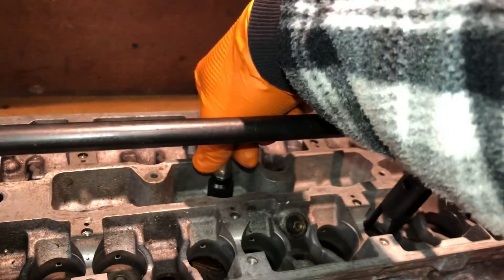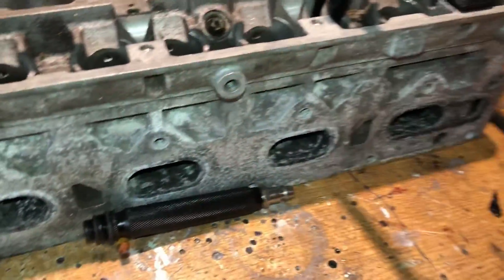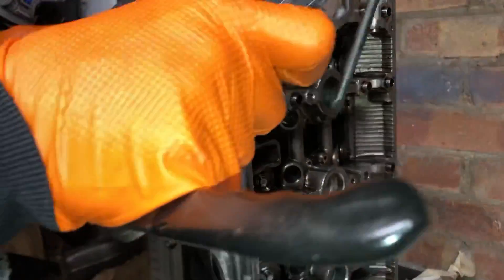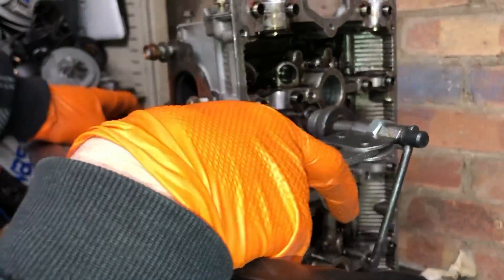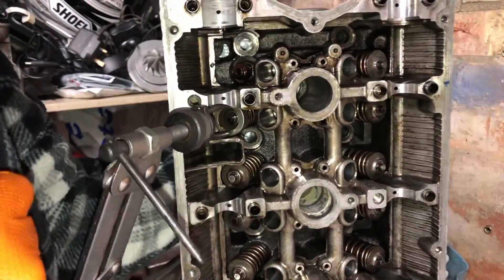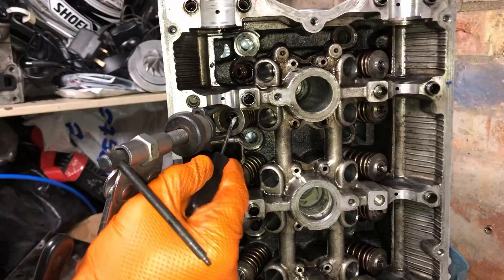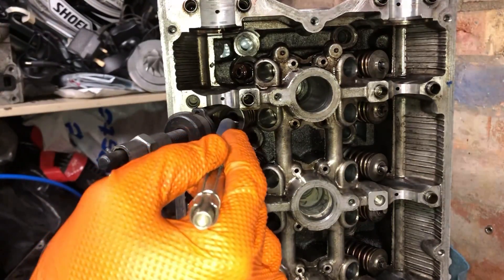That's a quick demonstration of how to work that style of valve tool. You've also got different adapters for the airlines that pressurize the combustion chamber — these are universal, not vehicle specific. But with heads like this with crazy high-pressure springs, this lever-style compressor is my go-to. It's a much fiddlier job to set up but a much more simple way to avoid valve damage. You just clamp off one side and push the lever to compress the valve spring, then remove the collets. I'll show you there are two different types of collets, because this is a race valve with a single groove collet.